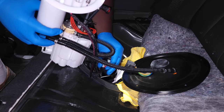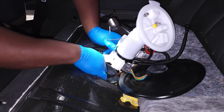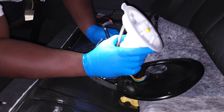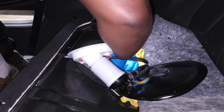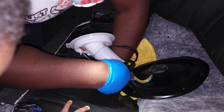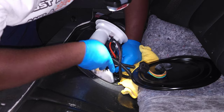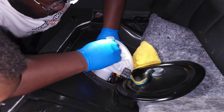The first thing I'm doing is dropping in the secondary fuel pump into the tank — I kind of moved it off to the side out of the way so I'd have a little more space. Then I connected the fuel line that goes to the other side of the tank to the bottom of the low-pressure fuel pump and rotated it into position so that it would be locked in. My top hat actually came apart from the main basket, so I pulled them apart and lowered the main basket down, and that gave me the extra space to reach in and connect the fuel line. Once all of that was connected, I used the basket to connect it onto the secondary pump bracket, snapped it in place, put the spring back onto the metal shaft for the top hat portion, and then lowered the top hat back into the tank and reattached it onto the main basket.